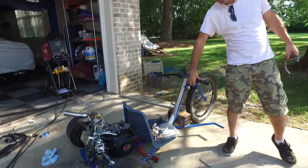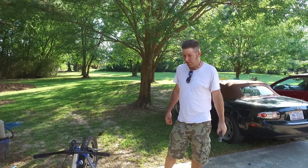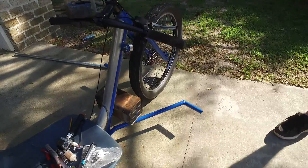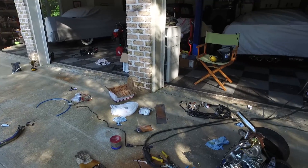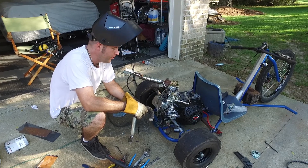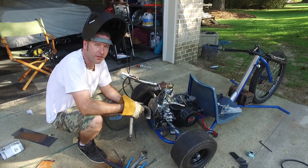I just got through hooking up the throttle — took maybe an hour. Now I'm about to cut up the turbo lines and the intake pipe. We did decide to use the original fuel tank to house the huge wiring harness. Now we've got to cut that thing open without blowing ourselves up. I'm welding up this boost pipe going through to the throttle plate — it's not pretty but it's what we've got right now, and we'll maybe change it later.